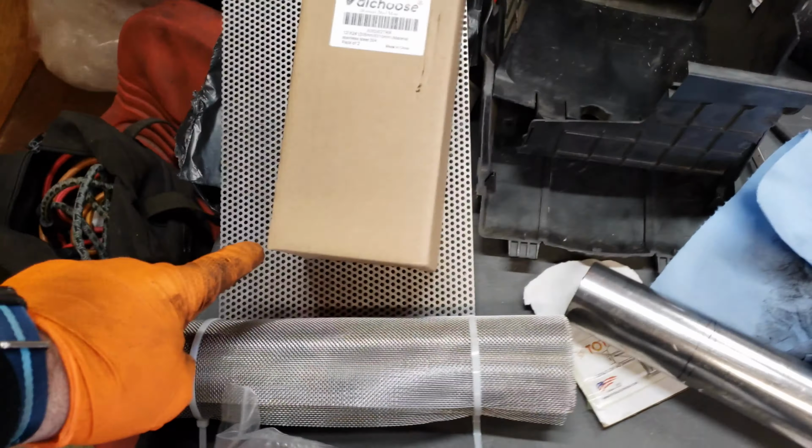So now that passes through. I just need to even up the other side. And I might even just pinch it back into the vise a little bit, just to round it out. All right, so there is that side, and I just need to even up the other side, and then I can just throw some tacks on it around each one of the ends.